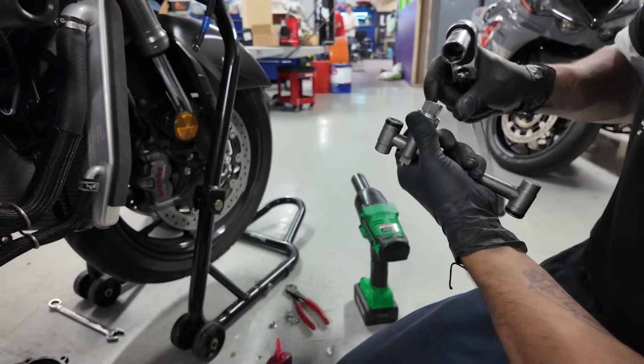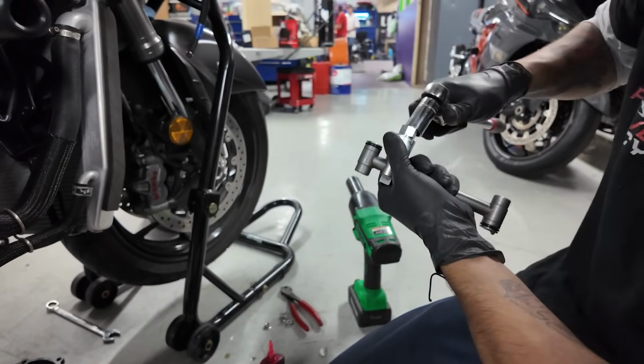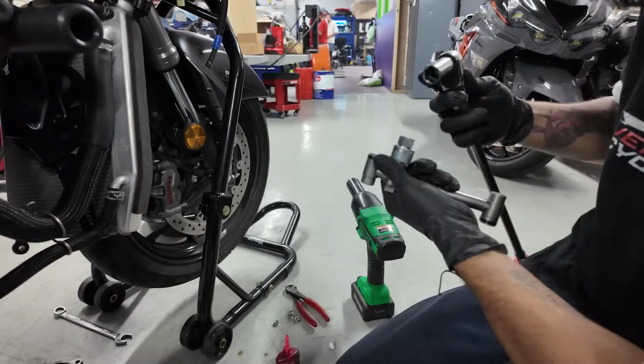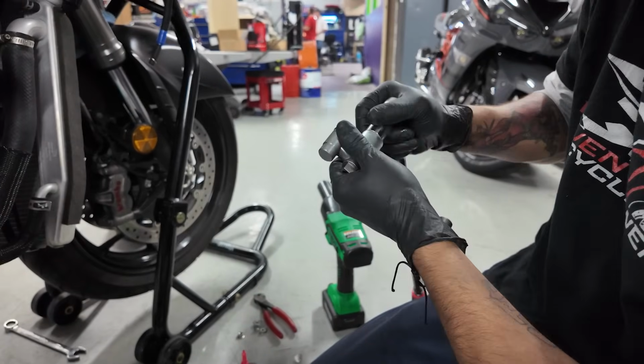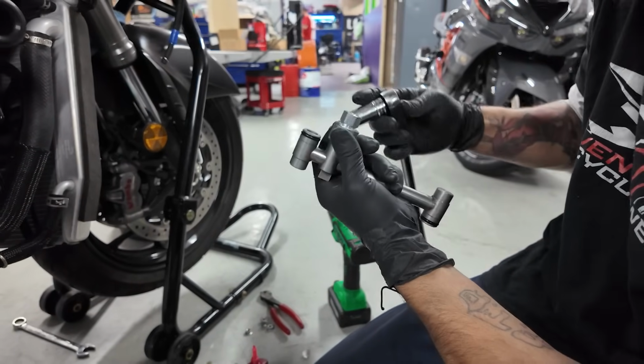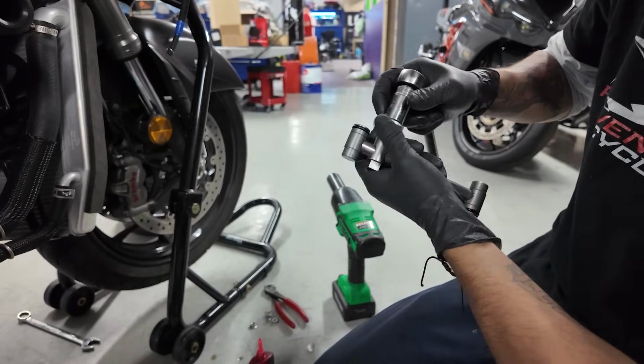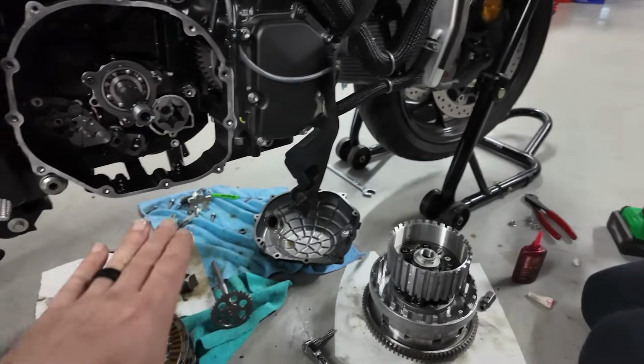And if you guys are running flat oil pans, another little tidbit for you is you're gonna have to shave off some of those threads on that relief valve so that it doesn't sit so low. That way you raise up that oil relief valve, so it's not bottoming out on the flat pans.